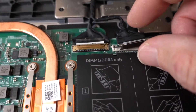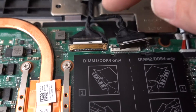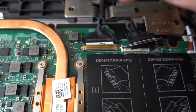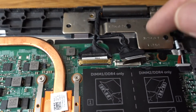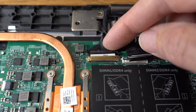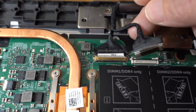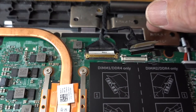Just had a thought — I think this cable is the digitizer and this one is the LCD. So instead of unhooking both and connecting a monitor, I was thinking about just totally disconnecting the LCD. But actually, if I just unplug the digitizer, I can still view it on this screen and see if it runs normally. I think this has to be it — this is the LCD cable and this would be the digitizer, the touch screen. So let's try that.